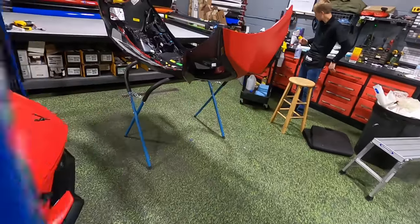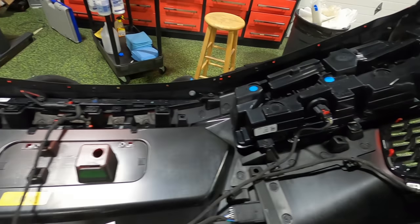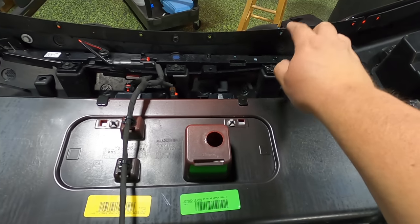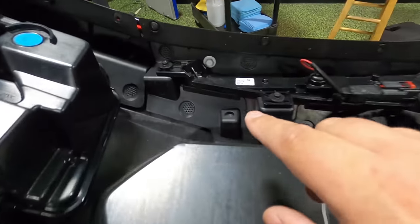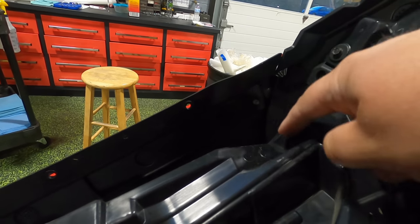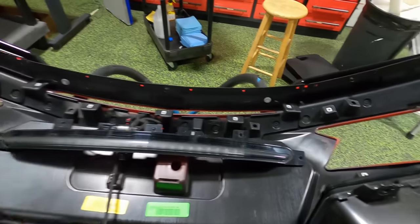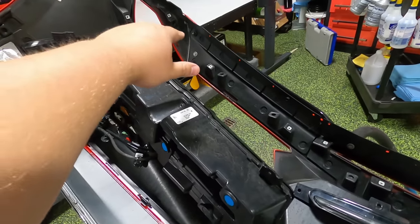They do have a bumper stand that I can set the bumper on. The screws we're looking for are actually hidden by a couple of different pieces on the back of this bumper, so to get this completely done, we actually have to remove both taillights and the center brake light, which is right here. These are all held in with seven millimeter bolts that will be pretty easily zipped out with the impact. Once those are all out, these are the bolts we're actually looking at — that right there is for the low wing Z51 spoiler.